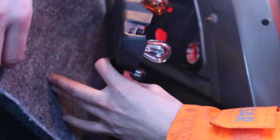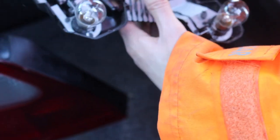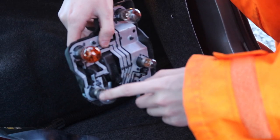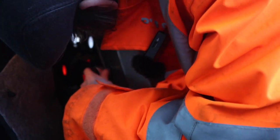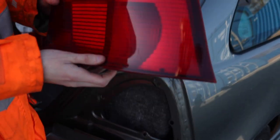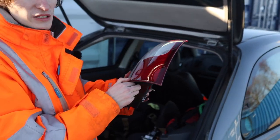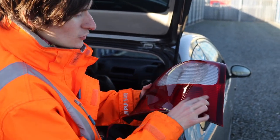This carpet has a screw here but they always go a bit dicky and come off. There you go — that's the back of the light. We need to suss out today: both fog lights have gone out. It's either a dicky connection or there's a fuse gone underneath the dash — we'll have to work that out when we put the others back in. In here there are three 8 mil nuts holding the light in. Actually, if you want a driver's side rear light, drop a comment below — it's got a bit of a scuff but it's good.